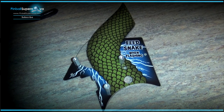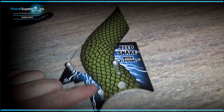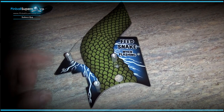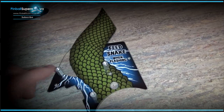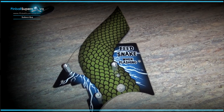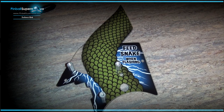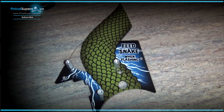Okay, so I drilled out my holes, and everything seemed like it worked okay. No cracking or nothing. So now I installed my stand-ups again that get put back onto the plastic piece. Again, it gets screwed from underneath, and then the standoffs, or whatever you would call these, for the plastic piece to go on here, like the ball protection so the ball doesn't get stuck up there, goes on top of that. So what we're going to do now is install this back into the pinball machine and install the components, and then install the sticker on the actual ramp. So we'll do that next.